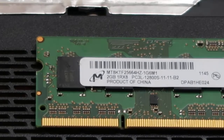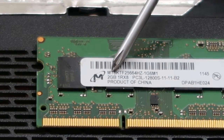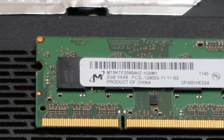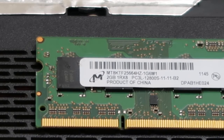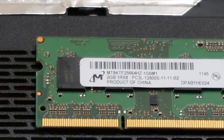So these are the values that you're going to be looking for — two numbers. The first number is the actual value of your RAM: two gigabyte. This can say four gigabyte, eight gigabyte, whatever. Now in order to know what kind of size to get for your computer, you want to know what your computer maxes out at. The thing with RAM is you can put however much RAM in a computer you want — it's not going to damage your computer if you put in too much RAM, but your computer is only going to use and access what it's designed to max out at.